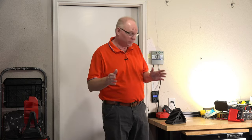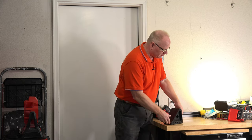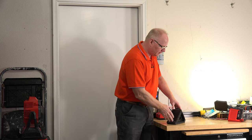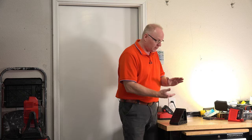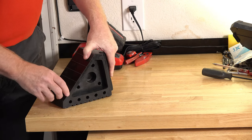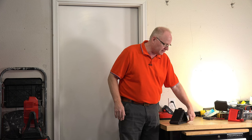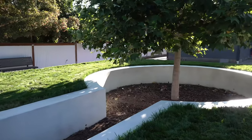Let's talk about what we learned about the wheel chocks. We already knew we could place them either way, but didn't know which was better. In testing, both ways seem to support the car. Wheel chocks work by creating an incline the car can't go back up — but that only works if the chock itself doesn't slide across the floor. To prevent sliding you need friction, and for friction you need maximum surface area. The side with ridges has points that give very little contact. With the flat side down, you have maximum surface area touching the floor — that's the maximum rubbing.